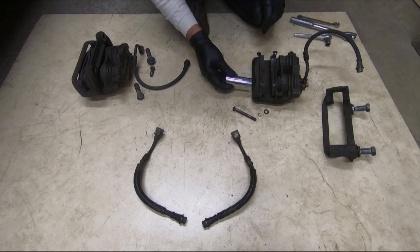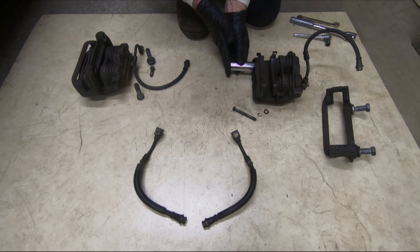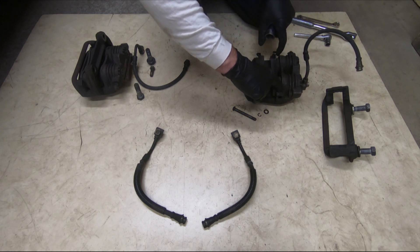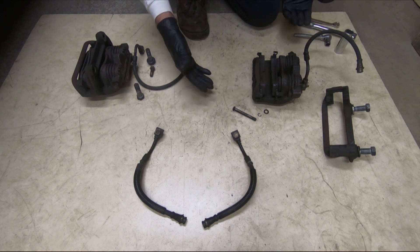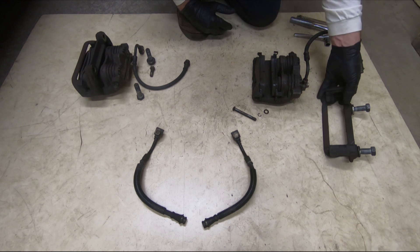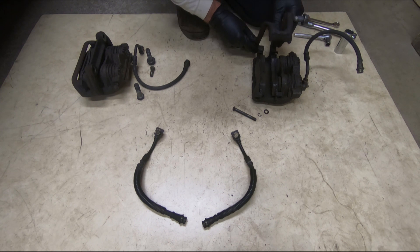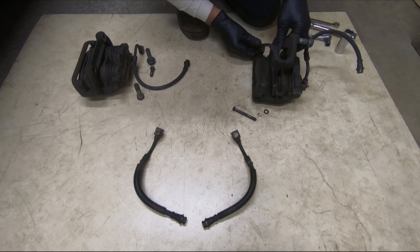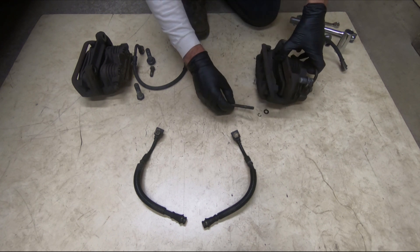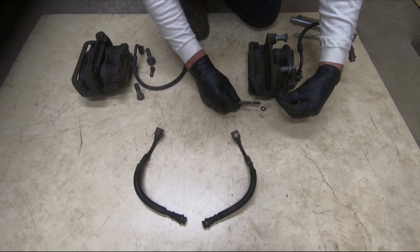Then you can remove the brake pads. It's not a bad idea — you get a socket that fits inside and you tap very carefully to tap them out. On the back you can use a screwdriver and pry it in a couple spots. And that guys is how you take the brake pads out of calipers. To put it back in, it's just reverse — the side opposite the pin, slide the pin back through, assemble the washer, and then snap on the e-clip.